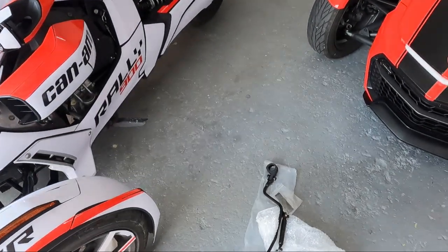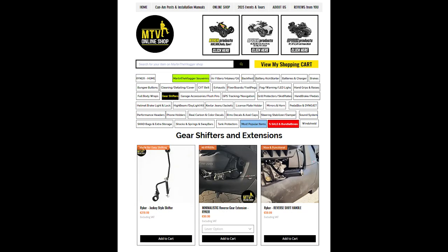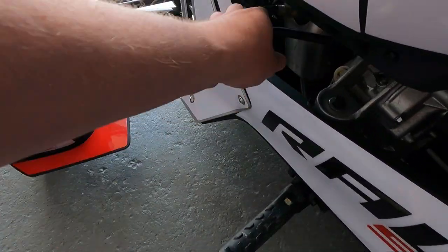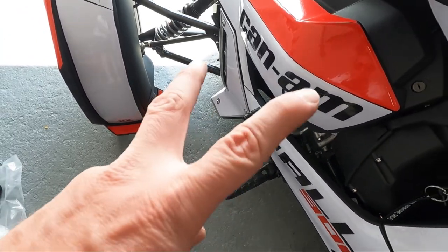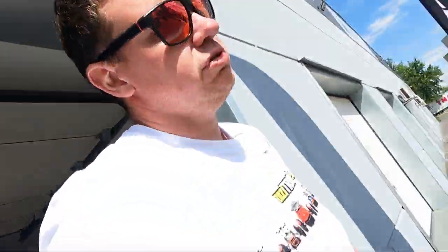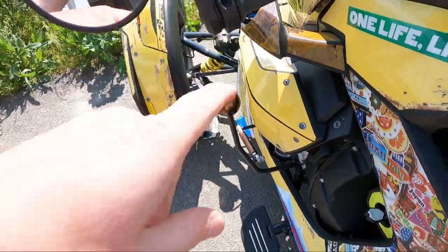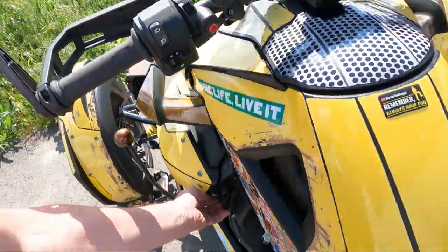Now on to one of my most favorite upgrades. We have a minimalistic gear shifter — super popular — but Igor went with my personal favorite: the jockey shifter. Apart from the obvious benefit when going forwards and backwards, it's almost impossible to find neutral with the stock setup when pushing the bike around the garage. But when you have a jockey shifter you find neutral very easily and you can push the bike with almost one finger.